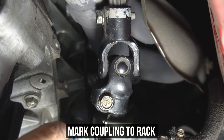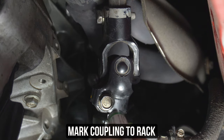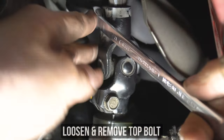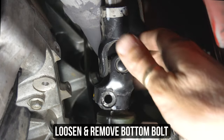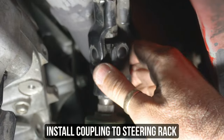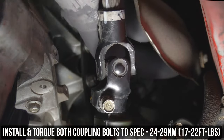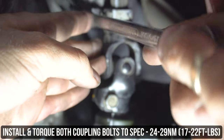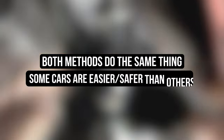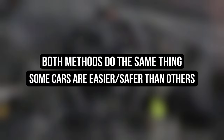The second way, if you don't want to remove your wheel or are concerned about the airbag, is via the steering shaft itself. As a good rule of thumb, mark the current location with a paint pen if you ever want to go back to the OEM clock position — mark both the bottom coupling and the top to the shaft. Then loosen and remove the top bolt, head down lower and loosen and remove the bottom bolt, pop the lower off the rack itself, head back into the car to center the wheel, then reconnect the coupling back on the rack stub, insert the bottom bolt and tighten, then the top bolt and torque both to specs shown on screen. It's the same result as doing it from the steering wheel, just more of a pain depending on your car model.